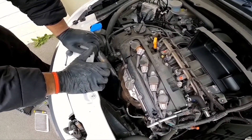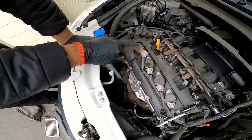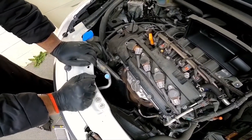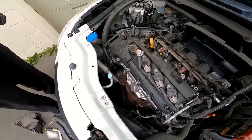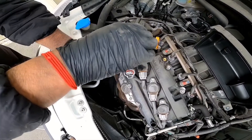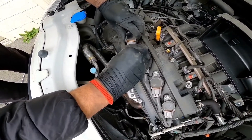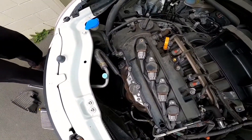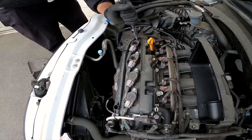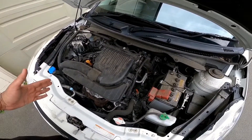That is one of the most common causes of a misfire. There are other reasons too, but too many to cover in one video. This is the best way to save money before calling a technician. Fit the spark plug back in and tighten it to the proper specifications, then refit the ignition coil, clip it in, and push it back into the hole and replace the 10-millimeter screw. I hope this video has been informative — please consider subscribing and check out my other videos.